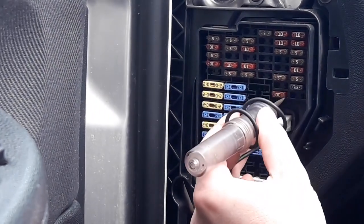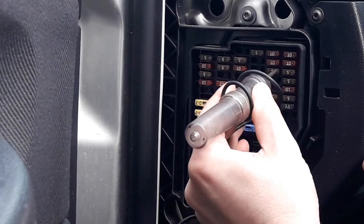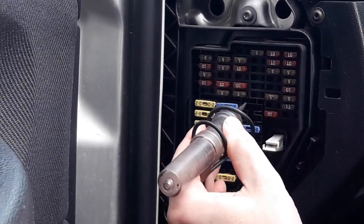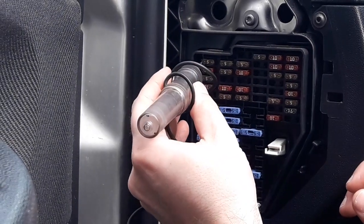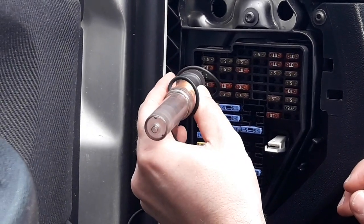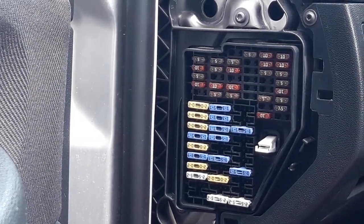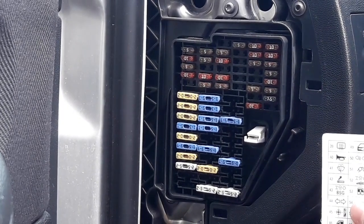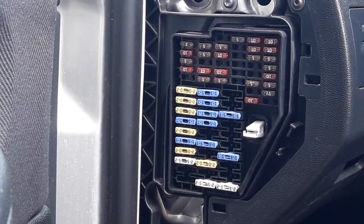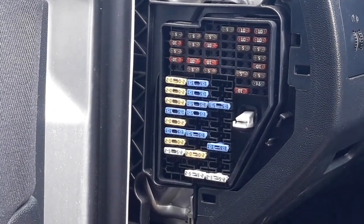If you want, you can check the other car fuses in that manner. Just have in mind that some work only when you give contact to the car. Others are always powered. Okay. The main thing for you to know here is, first of all, find the proper fuse. Second of all, make a test, and third, replace the car fuse.